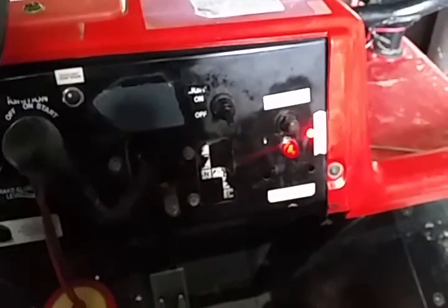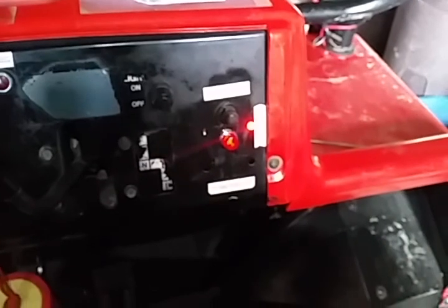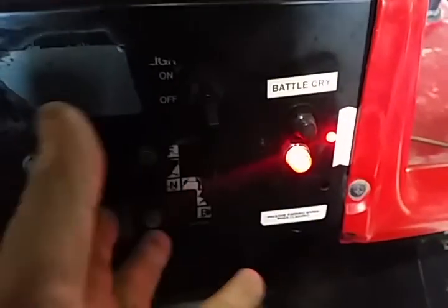Mule 2500 - a classic. Above my head you can hear the little orbital light letting everybody know where we are. That disconnect light is like our oil light - pressure's low. The engine's not running but we're in start mode, so that light comes on. With parking brake forward everybody knows you have it in forward reverse and it's not going to start. The old man had the issue where he would start it with the parking brake on and drive off, and other people would do that too, and that burned up the parking brake. The most obvious solution is to assume everybody will notice the blinking light that the parking brake's on and turn it off - but maybe not.